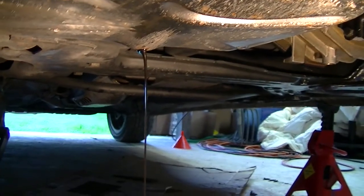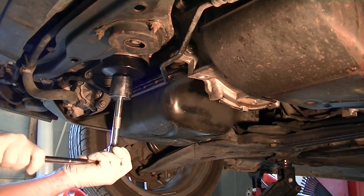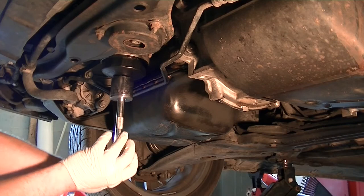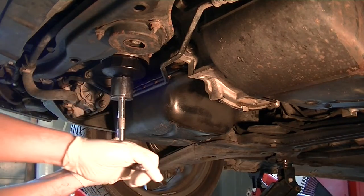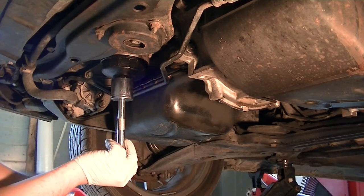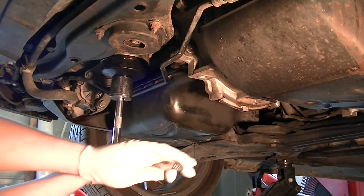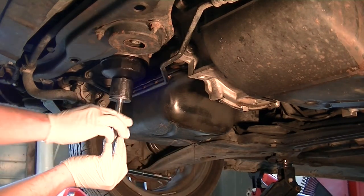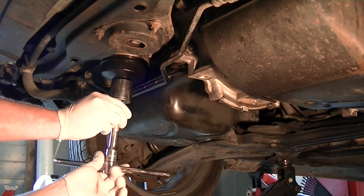First view of it. Oil filters are 36mm on these. You can take the drain plug out the middle, but you never get a new gasket for that, so I just take the whole thing off and deal with a slight spillage. Pretty good at dealing with a big spillage, so a little bit of filter housing spillage doesn't do much.